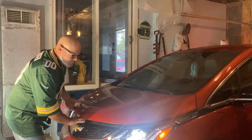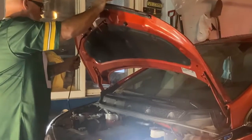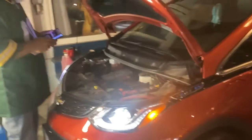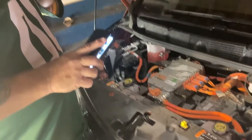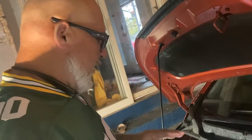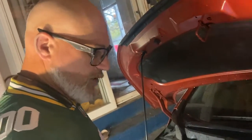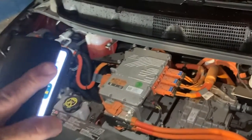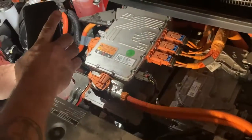This is a practically unopened hood. I've added 30,000 miles and there isn't a single wrench been turned on this anywhere. The things we've got to look at — at least once a week on your EV, this is something that EV owners don't really talk about a whole lot because it's bad PR. They don't want you to know this is a problem. On an EV, you have heat sources in here — things to keep that battery alive, a heater that heats that battery. And when wintertime comes, just like your house, mice like to get in and stay warm.